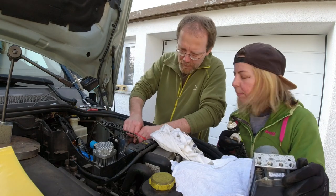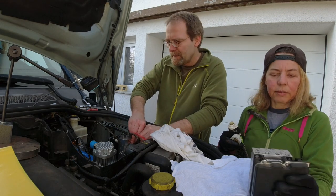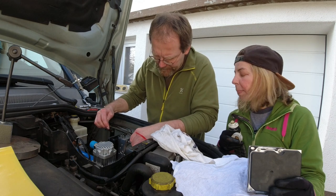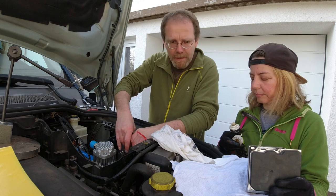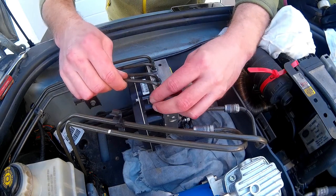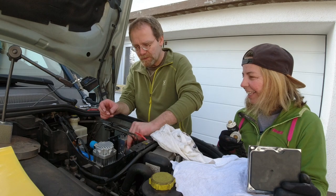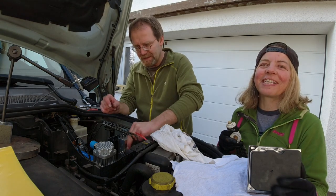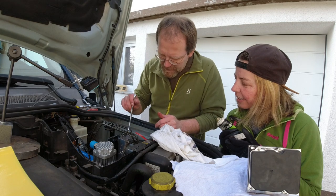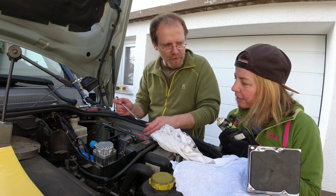Why is this fluid all red? We can't cycle the bleeding procedure automatically. I looked at the circuit diagram and tried to figure out how much of that circuit I can potentially not bleed — it's really not a lot, I would say less than a few milliliters. So it's going to accumulate some air, but once we cycle the ABS brake module, we find some dirt in Germany and hit the brakes on dirt. We're going to do that a couple of times and then just bleed the brakes again. Cycling this thing by hitting the brakes should get the air through the lines, through the module, and then we bleed it again.